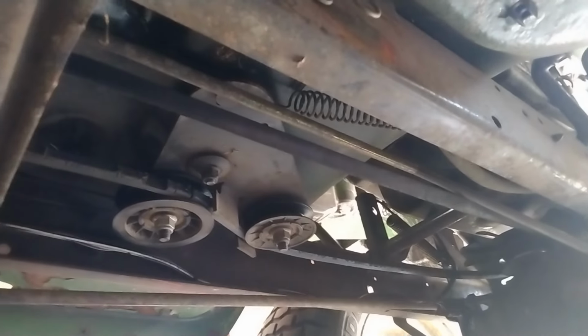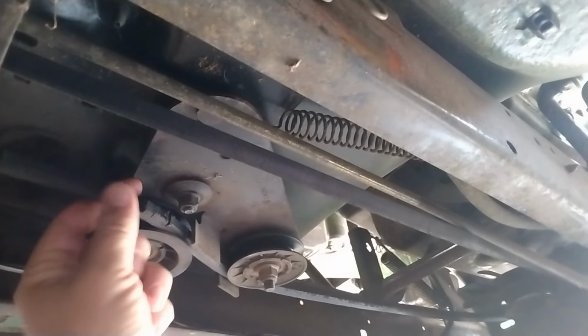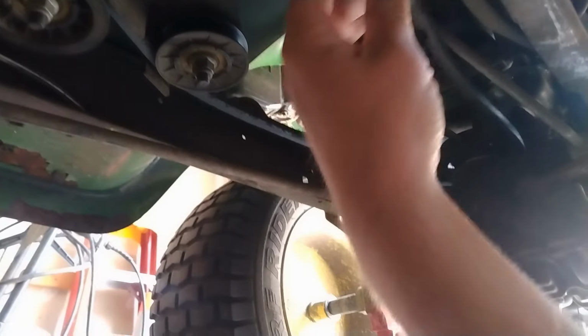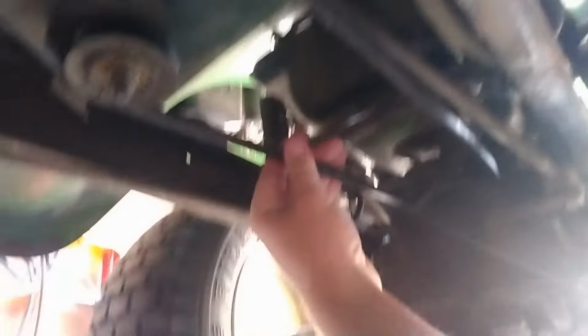Well, good thing the deck belt was giving me issues, because the drive belt is about to fail. And I thought I grabbed a hold of it. I must have grabbed a hold of a good spot when I grabbed the belt, and I just didn't feel it. There's a few areas that are not terrible, but this belt is so loose, too. That's entirely too loose.